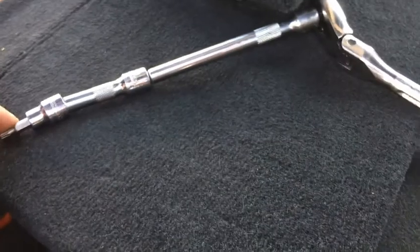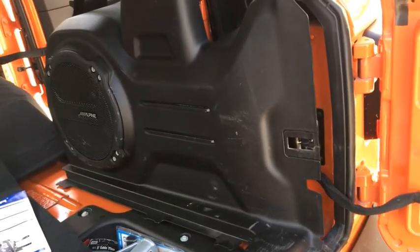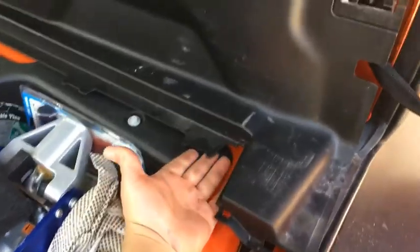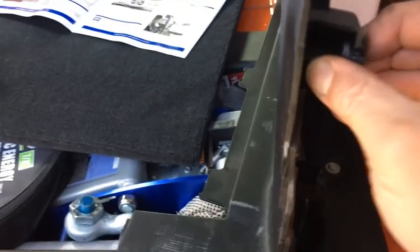Okay so it was a T20, just had to get an extension to get in there. I was trying to pry out this side panel here, finally just reached in and started pulling — pop pop pop. The clips were flying, but see these clips right here. Luckily it's not too old so it's not too brittle. Just put the clip back in and now I have access.